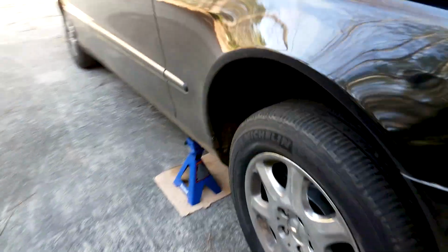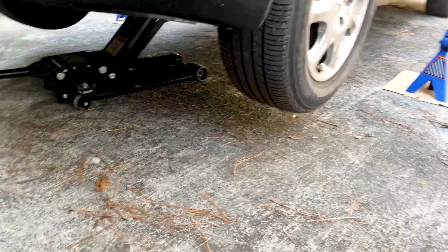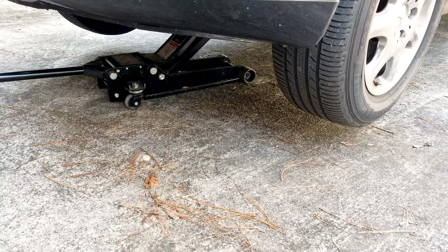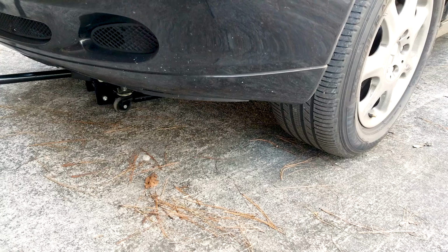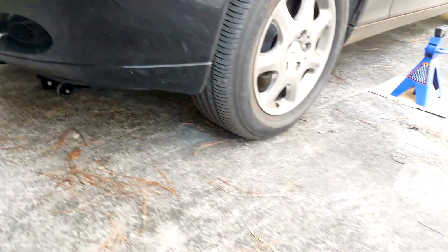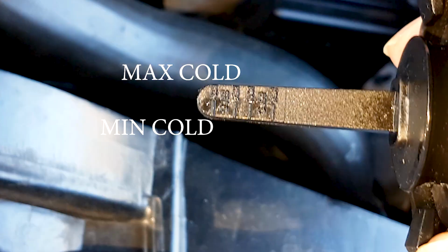Now, the dipstick, which is part of the tank cap, has measurements on it, minimum and maximum for cold engine, and minimum and maximum for warm engine. So 20 degrees centigrade and 80. So you want the fluid level to be between the minimum and max for cold engine. You can check it once you've done the flushing. You have just turned the car on and you have done the 15-20 turns right and left, so it's still cold, and so you want the level to be at the maximum of 20 degrees.